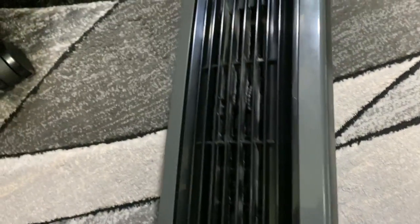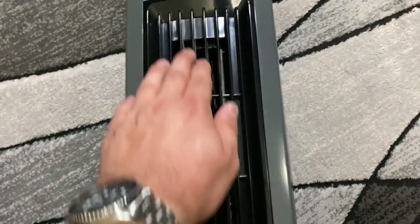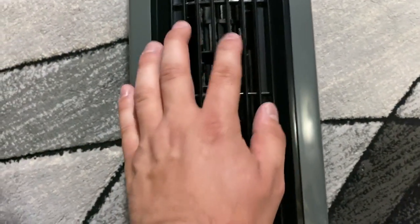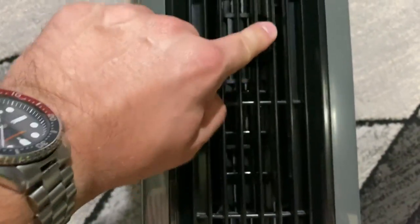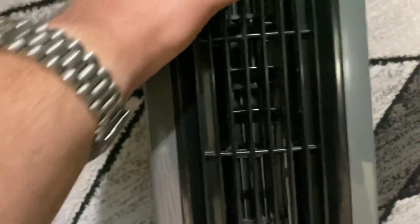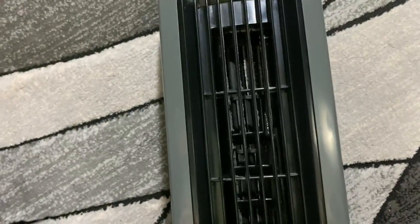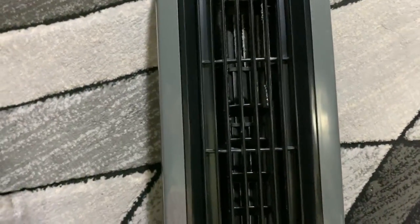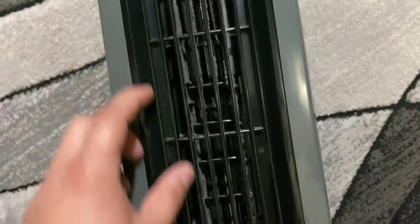This fan's not too bad. You can see it is starting to collect dust — when I vacuum I'll try and do the little top part, but you don't get all that much. It's worse with this adapter because you have even more obstructions to airflow that can collect dust. When I first had to do this, it would just blow chunks of dust everywhere every so often. I would suggest not using compressed air cans because it's too narrow — you'd go through so much it'd be cheaper to just buy a new fan. An air compressor is the way to go.